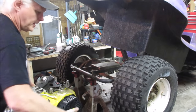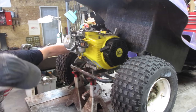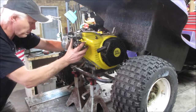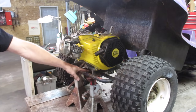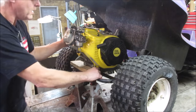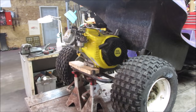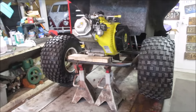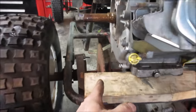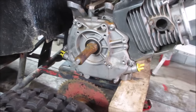The output side. Get up there. It would have to be, well, we can kick that sprocket over too. Let me get a little piece of wood to shim it. Like, we could probably either cut that base plate. Actually, the engine wouldn't be bad sitting in the middle like that. I think we can kick the sprocket over because we're going to have to get a clutch on there. The other thing too is the distance. That's pretty close. Let me go look for a clutch.